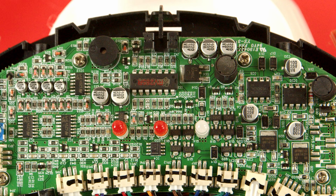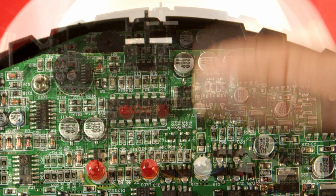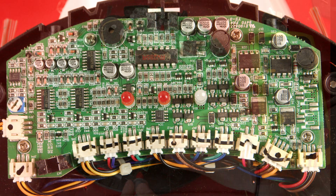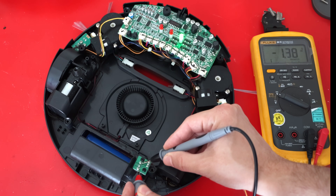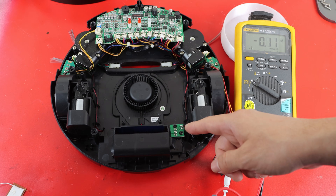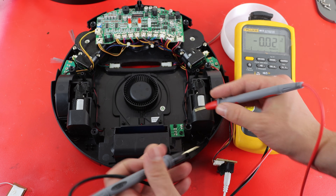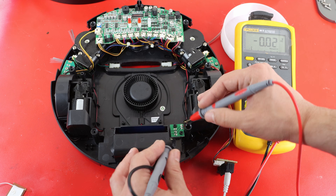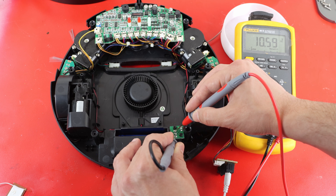There's a buzzer here. On the PCB we have one sensor used for the bumper, and another of the same sensor whose function I don't know yet. I'll put a high-res picture down in the description later. I recharged it but the battery depleted again, so there is definitely something wrong with the battery — understandable since it was left out in the rain. I found this a little strange and wanted to check if the battery had entirely died. But after the measurements, I think the battery still has a little bit of juice left — the LED is still blinking, showing it's getting charged, and in the multimeter I can see the voltage levels are rising.